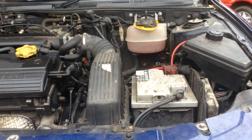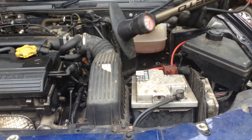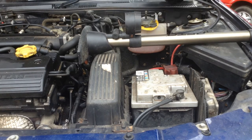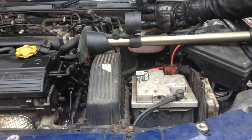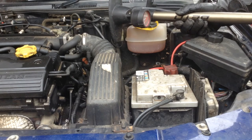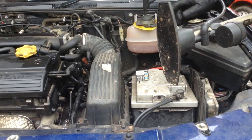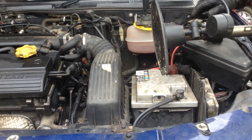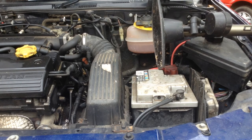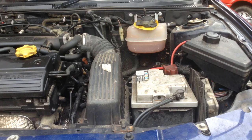And then you get your bicycle pump. Now, I've had trouble with this bicycle pump so it might not work. This bicycle pump here has a gauge on it, so it's a track pump — my mother bought it for me as a birthday present. Then you just pump it up to about 20 psi. It'll bulge out a bit. It's actually working. And you can use that to actually test the cooling system. Or what I did is I went underneath with a torch and found a leak from the head gasket. And that is how you pressurize the cooling system using a bicycle pump.